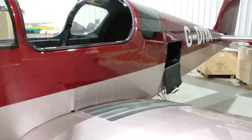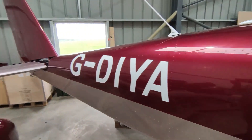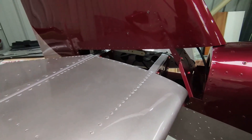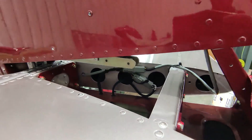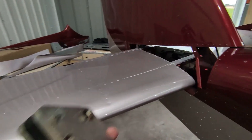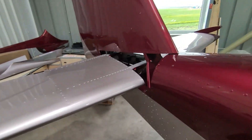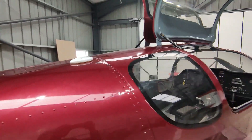You have to open up all the inspection hatches for the inspector to go through — pretty much every single nut and bolt is checked. In the meantime, the notification for the elevator counterweight removal came through. This is a mandatory change for the UK because of LAA requirements. That's about a kilo and a half that came off the rear, which effectively adds another five kilos of capacity into the baggage compartment while still staying within the aft centre-of-gravity limits.